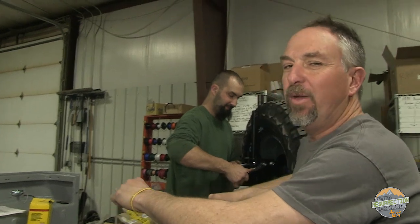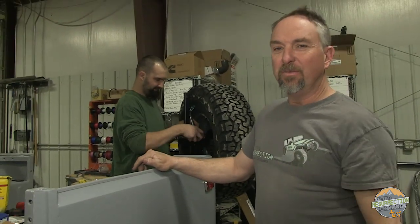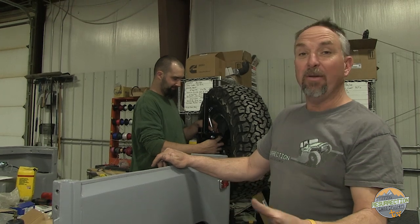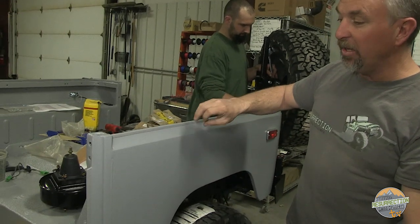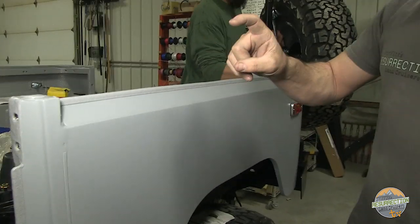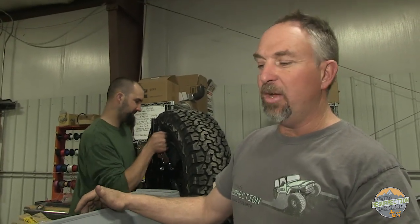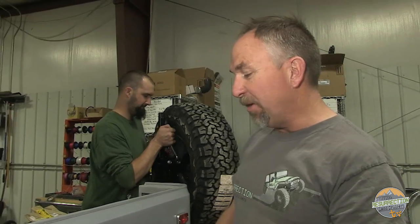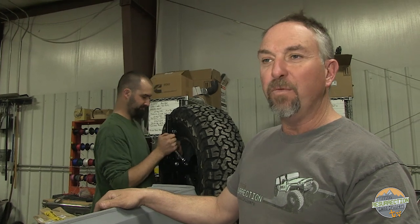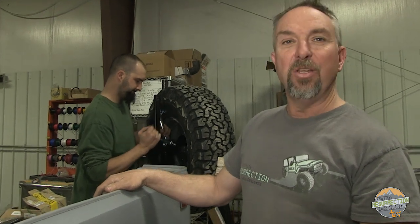Yeah. We have two rounds of primer. Round one primer, which is an epoxy-based primer, then round two primer, which is a sandable, and then sometimes there's a round two and a half, and then paint, right? But in this case, the joke, round three primer. Anyway, you actually have to be really careful with this, because if you scratch the shiny red one that we looked at a few minutes ago, you can buff that scratch out. But if you scratch this and you start buffing, it will become shiny. So if you scratch this, it's sort of unfixable once you do. So you have to be even more careful around this one than you do the rest of them.